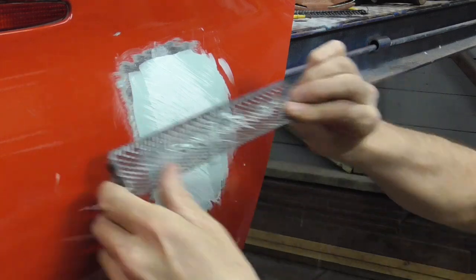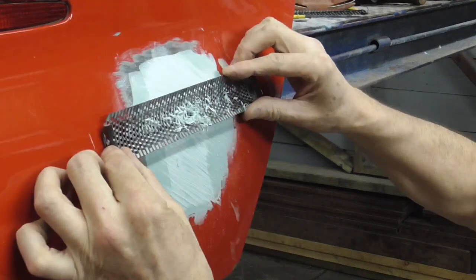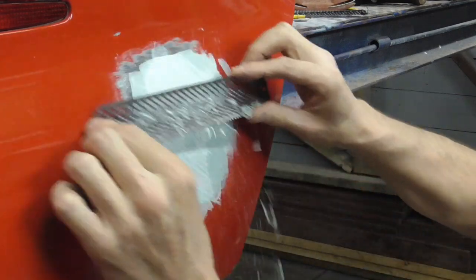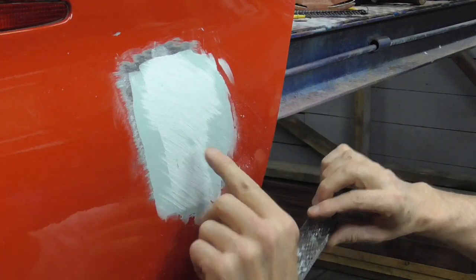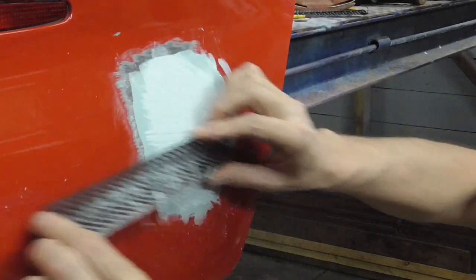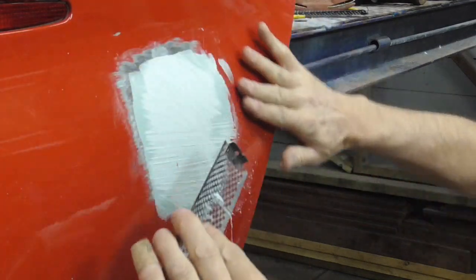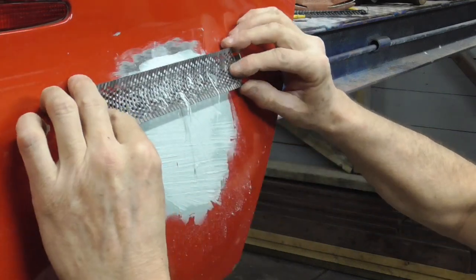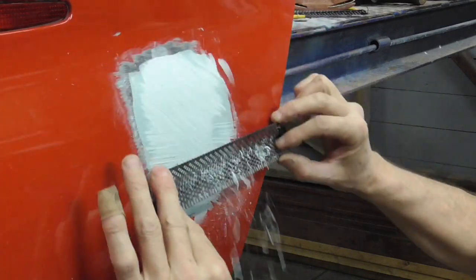I'm looking — I have a little curve here. I don't want to get too flat in one spot, so I'm sort of going up here and then coming down here so I want to have that curve. Here's my little low spot — I'm just going to let the tool cut right through that filler. I'm letting it follow the contour here, letting the end of this follow that contour so that it does the shaping of the filler for me.